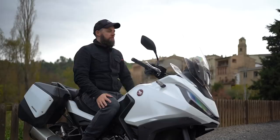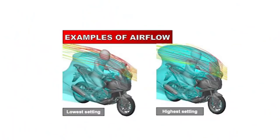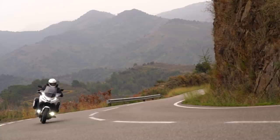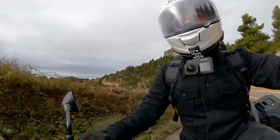This thing is super duper comfortable. First up, the wind protection. Look at this screen — it is a little bit tricky to adjust; you can't do it on the bike, both hands, you've got to hop off and do it. But it goes up or down by about 16 centimetres so there's a really big range. When it's down it's raked back, but when you put it up it stands up and that really changes the airflow around you. I'm about five foot nine and with it in the up position on the motorway at 70 or 80 it's perfect. These little deflectors or wings protect your hands a bit and push the air up over the shoulders.